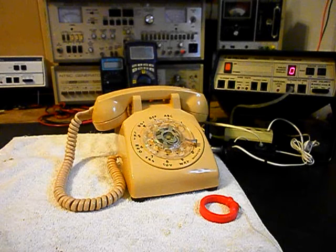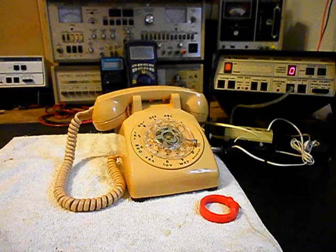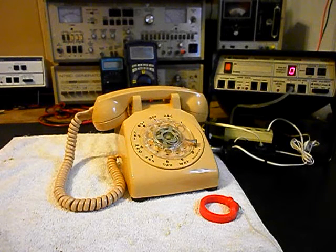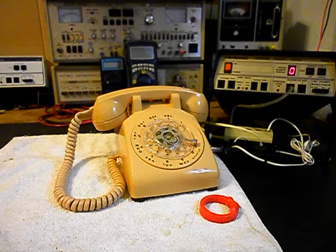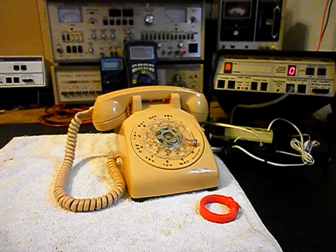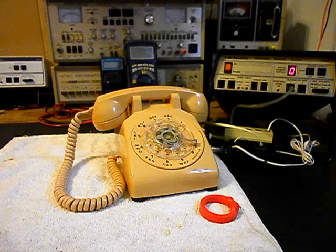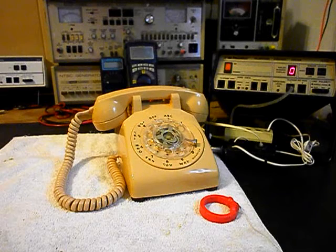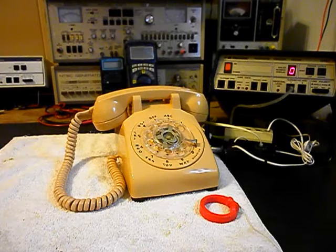The amplifier has a button on it. When I press that button, I can give dial tone or take it away at any time. Since it's an open amplifier, it is prone to any static interference or noise in the atmosphere. You may hear a little bit of an electrical hum, and that's normal. So if you hear any noise or static interference during the checkout, it will be coming from the amplifier and not the telephone.